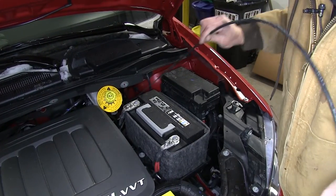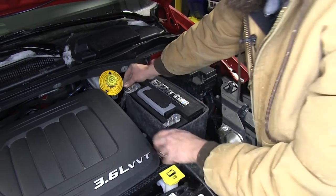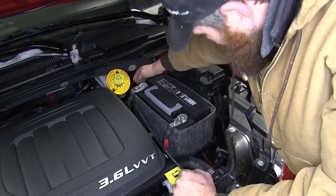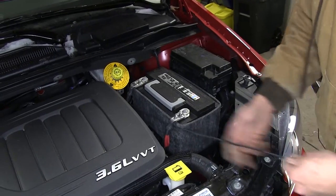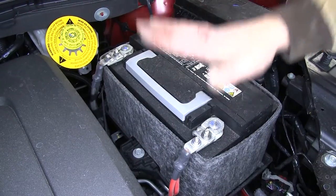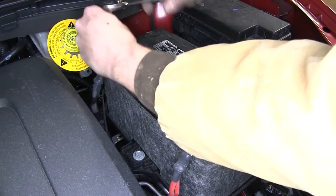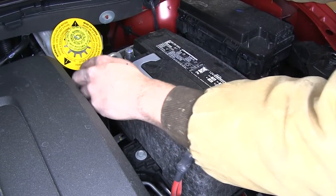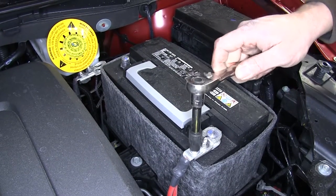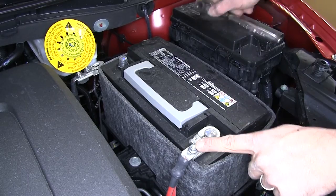Just keep pulling our slack up from the bottom, going under the negative terminal there, and bring it below the positive terminal. Before we make any connections into the electrical system of our vehicle, we're going to pull the negative cable off — this uses a 10 millimeter wrench. Just let it sit over here where it won't make contact. Then we can loosen the small 10 millimeter nut located there at the positive terminal.